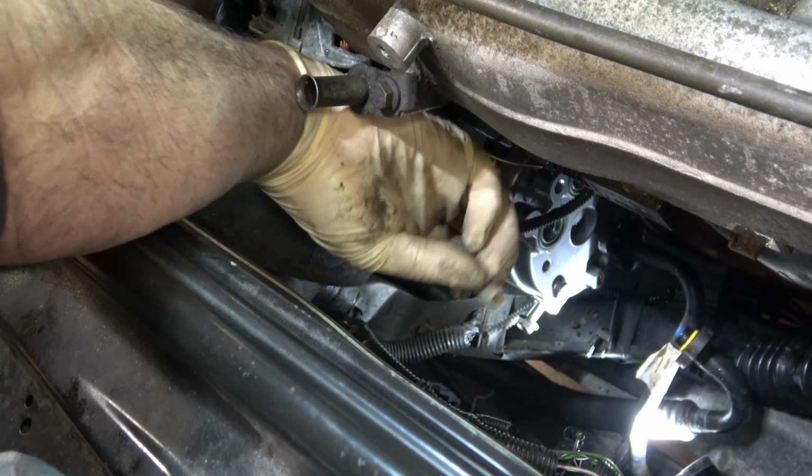So I put two new O-rings there. When I am ready to go ahead and reattach the two hoses, I will replace those as well. You definitely want to do it. I've replaced compressors on these before and tried to reuse the inner seals, and that usually doesn't work out. You'll end up with a leak, and that's a lot of time to get back down in there and fix that. So it's best to just do it right the first time.